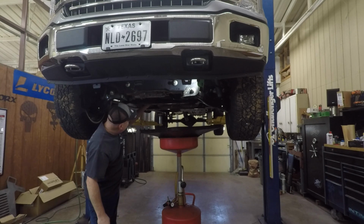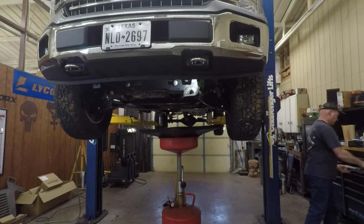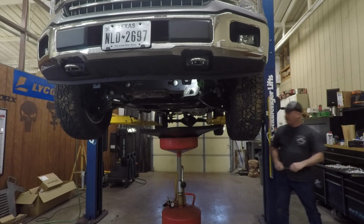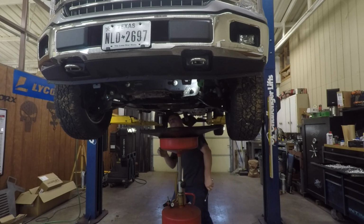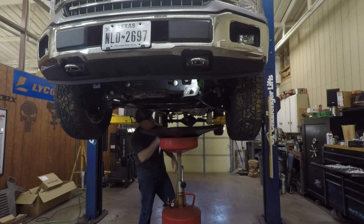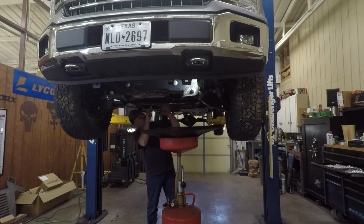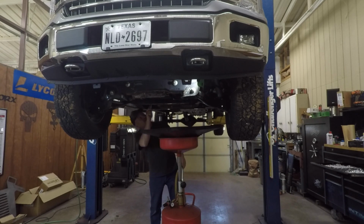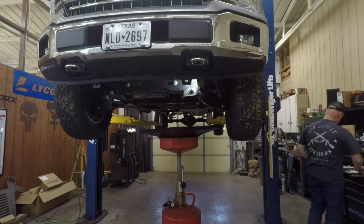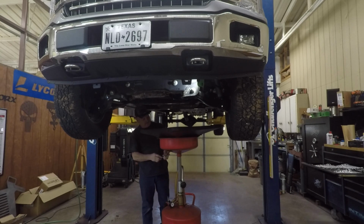Oil pan is right back here. And they used to take a 16mm wrench. I'll see if this was the same. Some of the engines have a 15. Let's see what this one has. I've never changed one on this year model. Yeah, they changed this. I think this was a 15. Well, they may have changed it to a 14, which would be unusual for Ford, but let's see. No, they didn't. Well, that's strange that a 15 felt a little loose. To be sure something crazy isn't going on here that it's not a 9/16. No, it is a 15, okay.